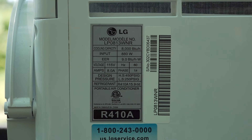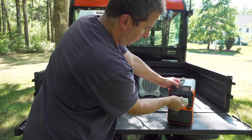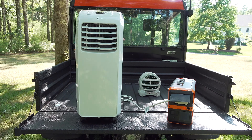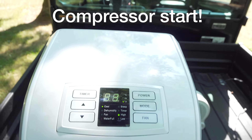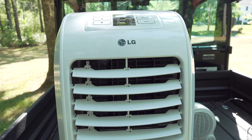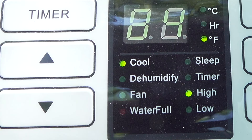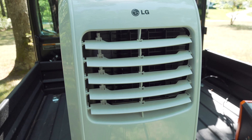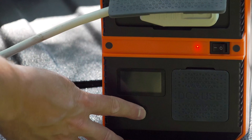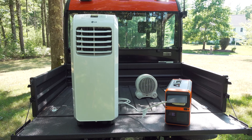It's a full size air conditioner — about 8000 BTUs with a running wattage of about 900 watts. The key here is it uses a compressor, which can wipe out units all the time. But that noise you heard is actually the compressor starting. This thing was really impressive — they said it had a 3000 watt surge capacity and it had no problems at all running the air conditioner. That's the big problem because many units cannot handle that start-up draw, so you'll have no issues running either an AC or a refrigerator with this unit.